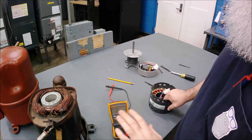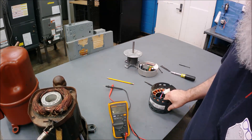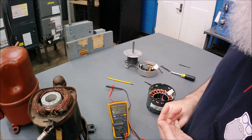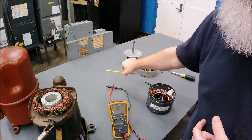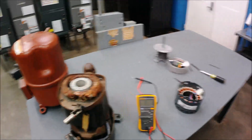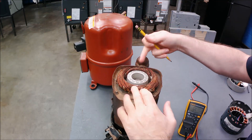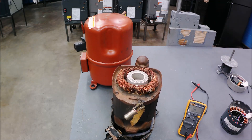Some differences, but understand that just because you see three wires or three terminals does not mean that you have three windings. That would be true in a three-phase motor, but not in your residential-style single-phase PSC. A lot of what you're going to see — you don't get to see the inside of it, we just see a shell — but you've only got two windings in there. Hopefully this makes some sense and it wasn't 27 minutes long.